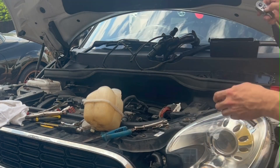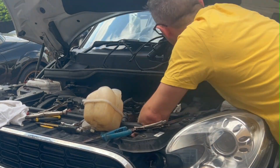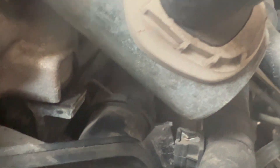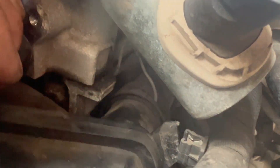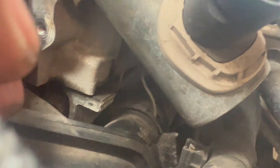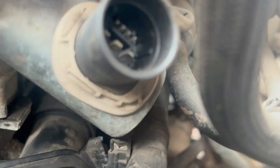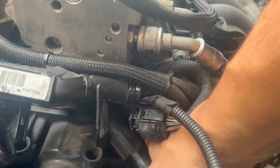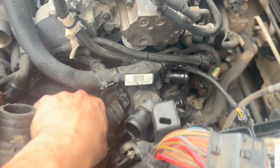Once all that's out, there are three bolts to back out that hold the thermostat in. Then there's a near-impossible clip to remove on the rearmost hose. Getting it off is not so bad but putting it back on is a nightmare. If you're not sure you've got the tools to get in and refit that clip, don't take it off — it will not seal, so just leave it. Then wiggle the thermostat out — it does come out eventually. Compare it to your new one and swap over only the smaller hoses before you start to put it back.